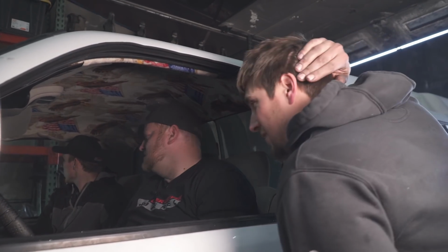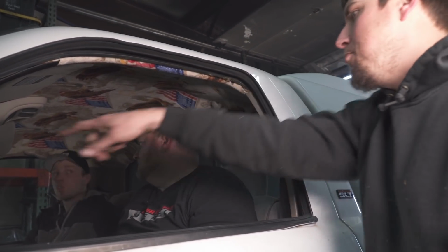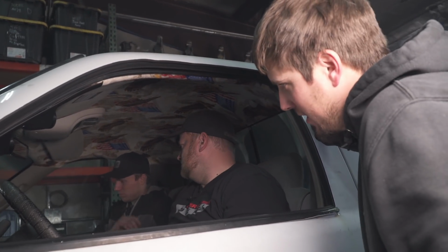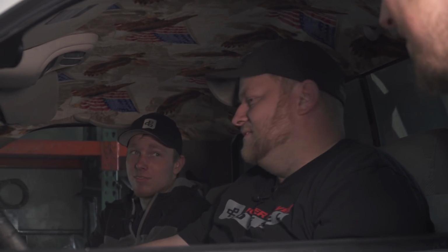How hot did it get? 1600. And it was cooler with the 75% alcohol mix and the lighter nitro mix. Right, but if it's all burning right in the manifold, that might be a false high on the EGT. Well, maybe we just need more alcohol to support combustion because there's so much nitro in there. We need to get rid of some of the water and replace it with nitro and alcohol. I would be curious to see what nitrous did with this. I mean, you added more fuel, you need more air. That's very true.